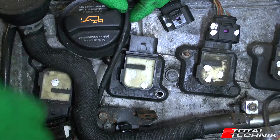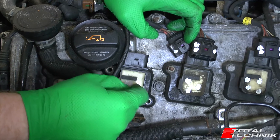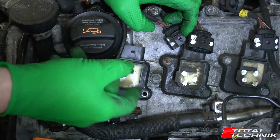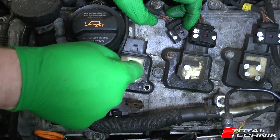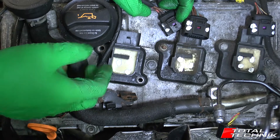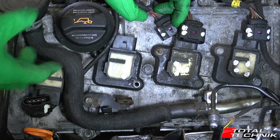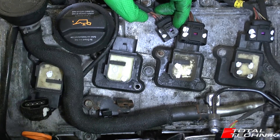Under the coil pack — and we'll show it to you later in the video — imagine the bottom of the coil pack is like a stick with a socket that fits over the head of the spark plug. It's rubber inside, so it sits quite tight on the spark plug and makes a bit of a seal. When you pull this off, that's the seal you're trying to break — it can sometimes be quite tight. You can get proper tools that slide onto the little notches and allow you to pull it off, but I'm going to show you the more DIY-oriented way, since you probably don't have the special tool.